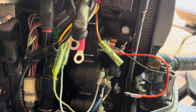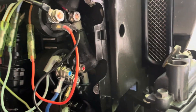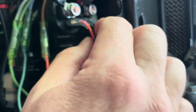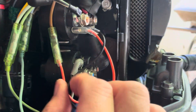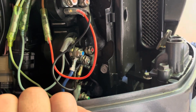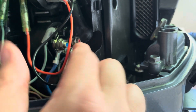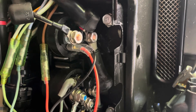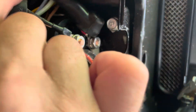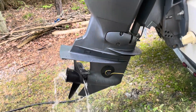Hopefully that's not going to be an issue. Everything's in place — those 10mm nuts are tightened, the connector does in fact fit now that we crimped down the female side, and the black wire ring terminal has been connected. All we have left to do is slide the boots down over those nuts to protect them from shorts. Water's hooked up, let's crank it and see what happens.